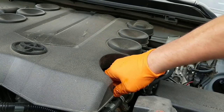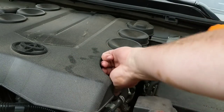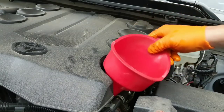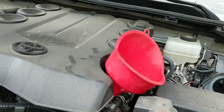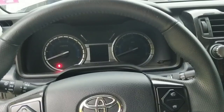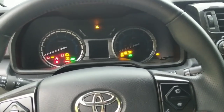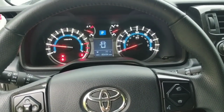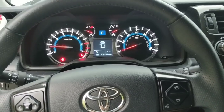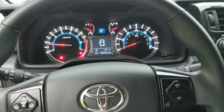We're going to remove the oil cap and insert our funnel. This takes 6.6 quarts, so I'm going to add 6.5 first and check, since there could be some oil hiding in the motor. Putting 6.5 will not hurt your engine — just put a little less than 6.6 and then we'll check the dipstick. Back in the truck, I'm going to crank it, make sure we don't have any warning lights, and let it run for about 5 minutes. Then I'll show you how to reset the maintenance reminder and check the dipstick.